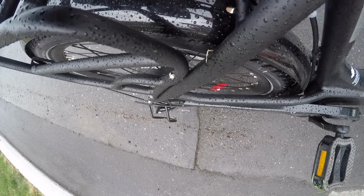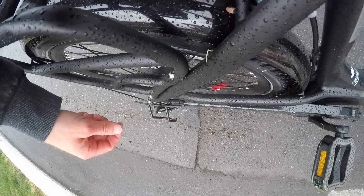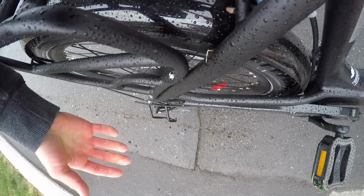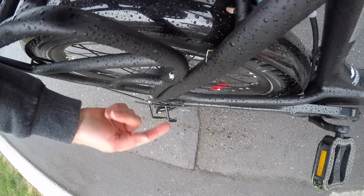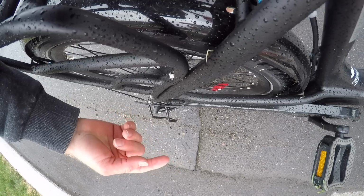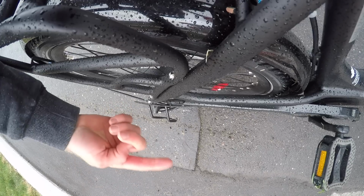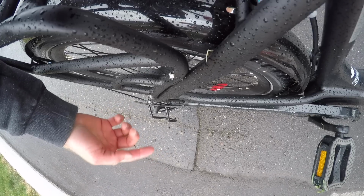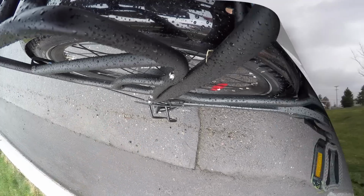Yeah, seems like everything's working pretty well. Again, a little bit slow on the take up occasionally when I do pedal assist. Only 8 magnets versus 12, so lower resolution. Maybe some bouncing on the chain. Not entirely sure. And then I want to mention the front disc brake rotor is 180 versus 160 in the rear, and most of your stopping power does come from the front wheel. So it makes sense. The whole setup's working kind of as expected and pretty well.